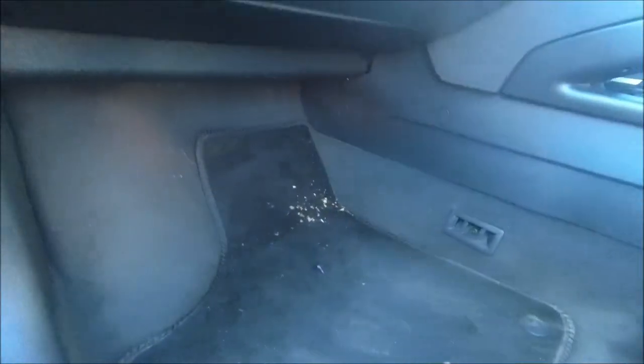I need to see it so you'll have to wait. That is back in place again. Now I need to put the trap door back on there. I doubt you can see a thing — but the trap door's back in place. That was an appalling video, sorry! The cover goes back in. It's on the passenger side under the glove box — pull the foam cover down, there's a door that slides towards the outside of the car, pull the old filter out, slam a new one in.